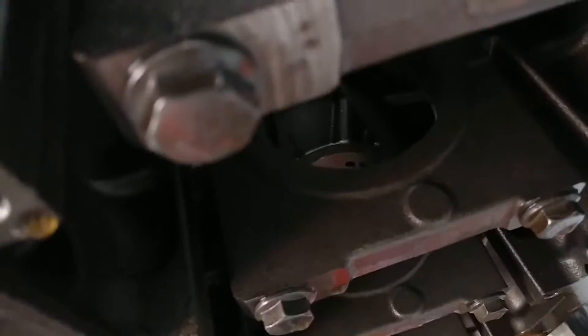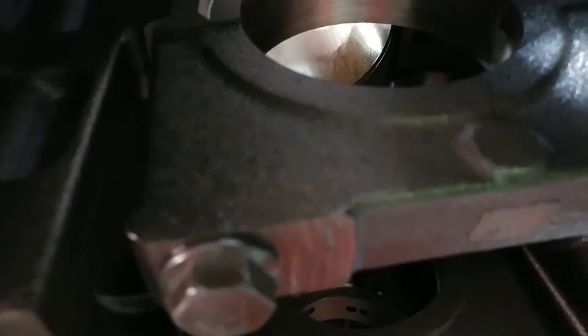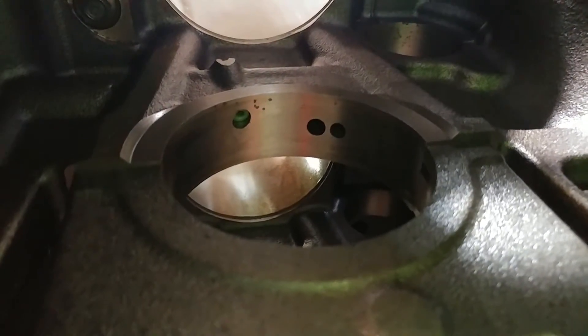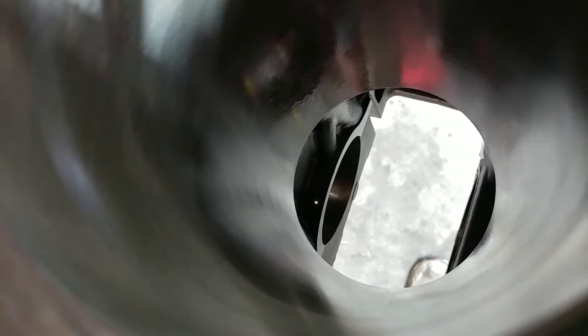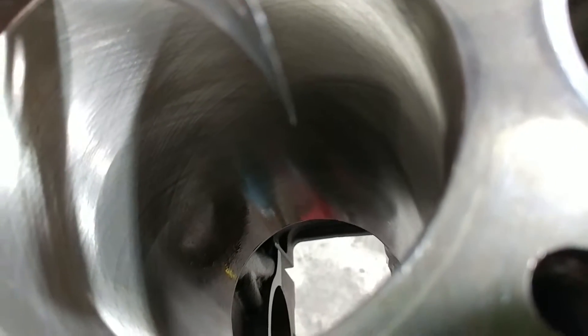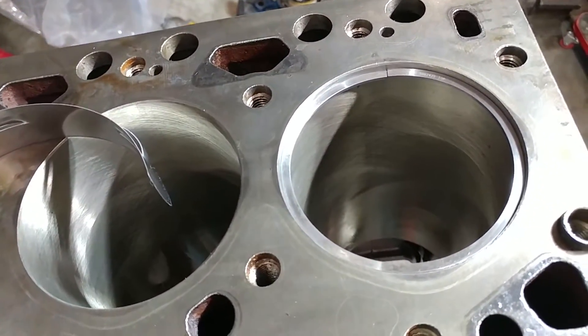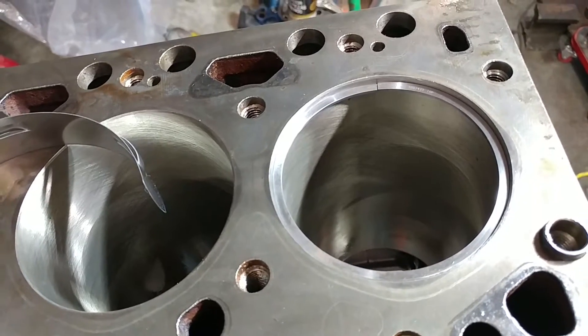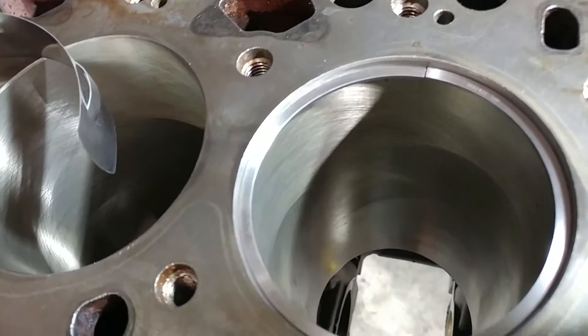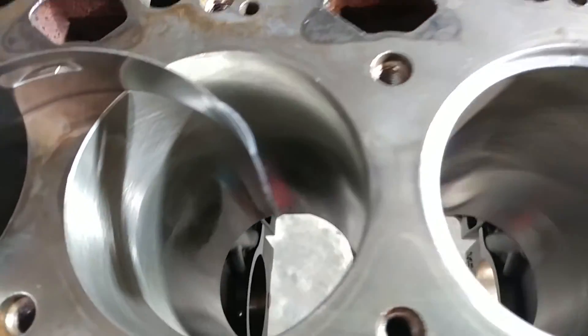Up in there are your saddle jets — you can see the green on the bottom of the saddle jet. That jet is angled so it sprays on the bottom of the piston. You can actually see light coming through one of the saddle jets. This is an early 2003, so it has 24-valve rods — not common rail rods — with machined caps, and it still has the old-style piston cooling jets.